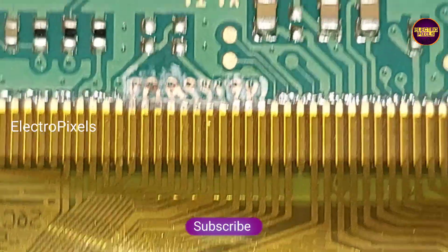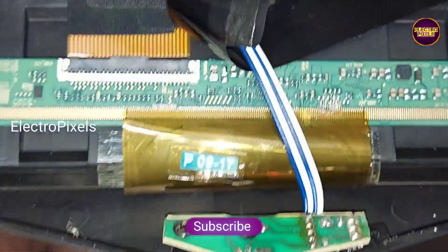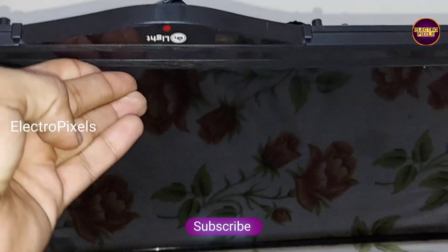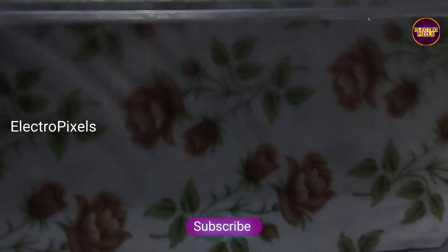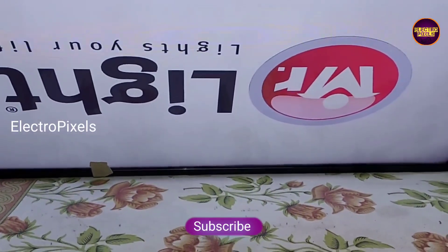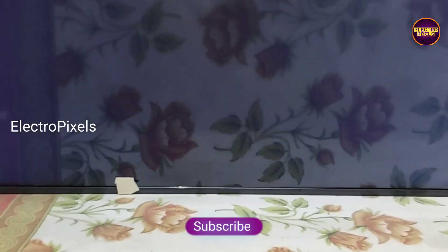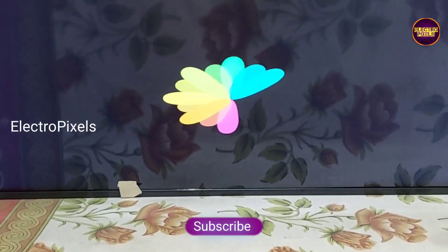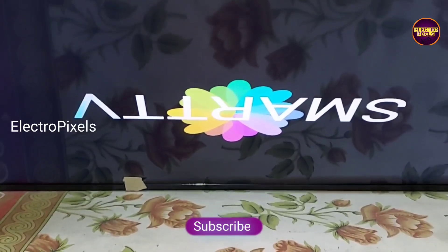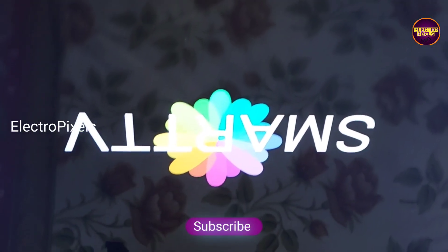Now in this condition, let us turn on the TV and check the picture. The TV is now turned on — you can see the red light indicator. Let us release the TV from standby. Finally, you can see the result: the TV is released from standby, the picture is showing, and the MR Light logo comes up. This means the display is now working properly. The fault was with the left side gate signals, so after blocking the left side gate signal tracks the display is okay. Remember, this is just a temporary solution and the permanent solution is panel replacement. At present the display is working properly and the picture is crystal clear.